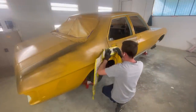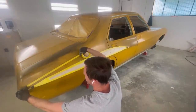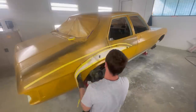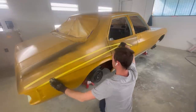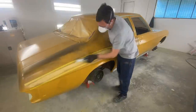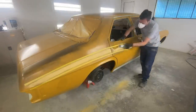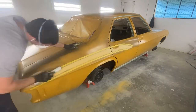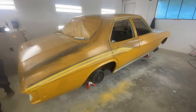If you've seen the previous episode in this series, you would have seen I've put two coats of polyprimer on top of the boot lid, the roof, the bonnet, and basically the lower halves of the sides of the car, and three coats across the top. Basically what that's allowing me to do is get a nice build over the top of my repairs and really fine tune some of those repairs, get rid of some of those block marks, and basically dial in on some of the harder areas to body work.